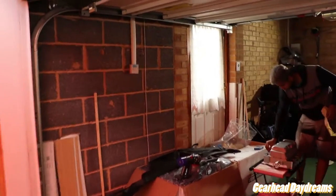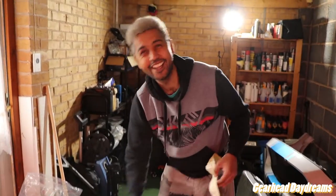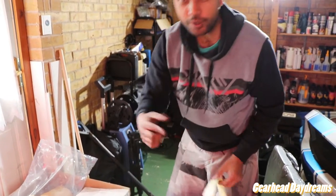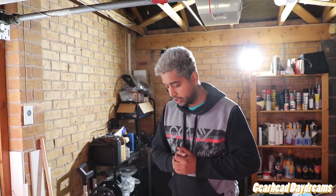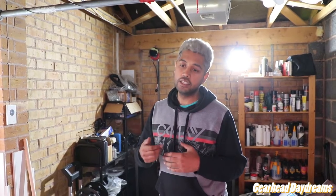Okay, day two, Kenne Bell supercharger install. Asmund, where are we up to? Didn't see you. So we had a bit of a nightmare yesterday, which you've probably all seen. Yeah, it was bad, but we're okay. We managed to drill most of the old nut out, the bolt out, and we re-threaded it to M6. The problem we found was all four of the holes weren't tapped in deep enough.